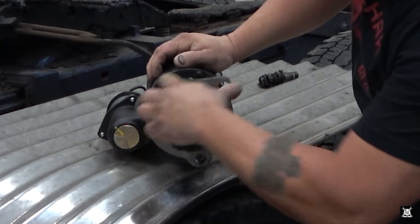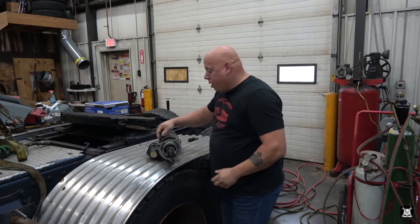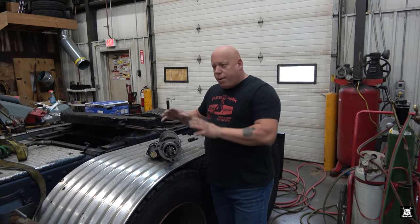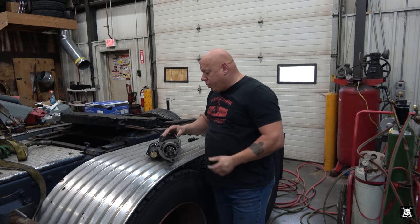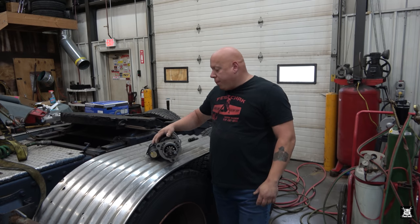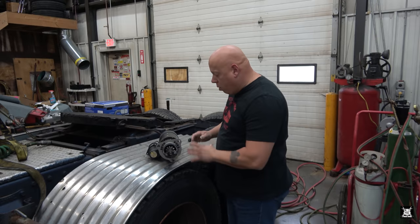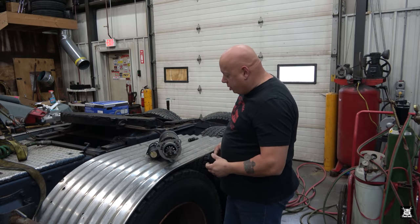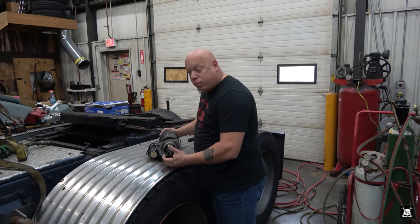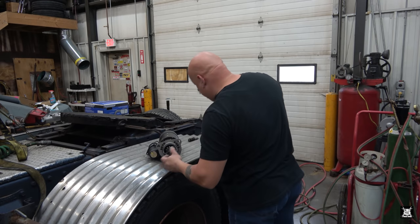If you take these bolts out and these plugs, you can change the clock position of the snout, because depending on what kind of truck it bolts into, it matters how this is positioned. So you back these off and change that clock position. In this particular application, the starter solenoid hangs low. So we have to set it up so it does exactly that and clocks it properly, which it may actually be. Let me go ahead and set it up how I have it on my phone. Let me go get the phone.